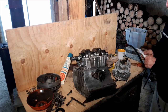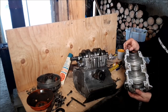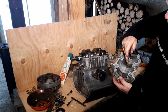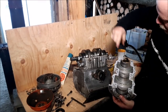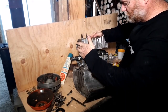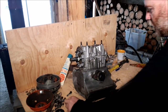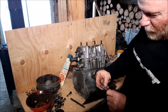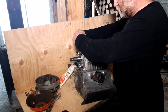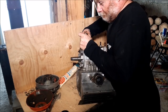That stuff squishes out pretty good as well. Easy to get these on right too. You can see that this is the wide spot, narrow spot. Narrow spot, flywheel side, wider bearing, PTO side. Lift this up, set it right on. Should sit for about a minute. I'm gonna start threading these in. Now, some people put blue Loctite on these. I don't bother. Good.